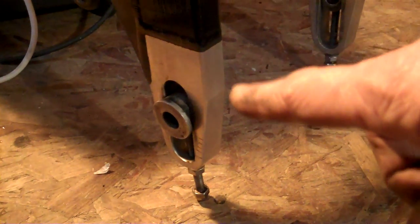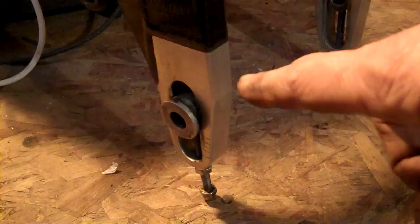And of course you might say, fabulous new swing arm, and you're giving it brush paint with blackboard paint, but then it's going to protect it, because I'm going to neglect the bike. It is a survival rat bike. It doesn't get washed or cleaned. Good thick coat, and I mean a really thick heavy coat of water-based blackboard paint. That's going to protect it. That's going to keep the corrosion off the alloy. I've left the billet adjusters because they just look cool. I want them to be seen.